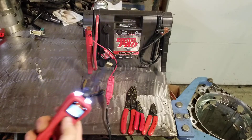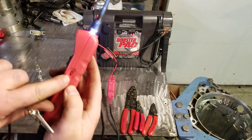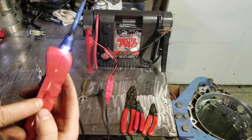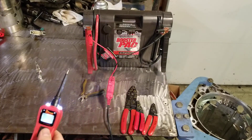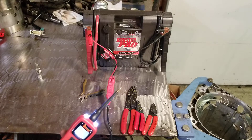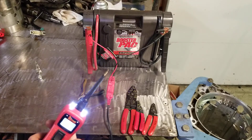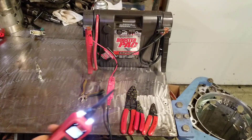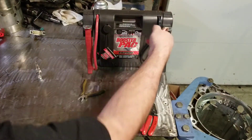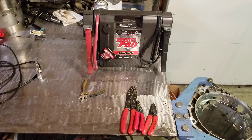These can be handy, but the problem is if you're just poking around and applying power to stuff, you can damage things if you apply power to something you shouldn't. They have a breaker that trips to keep you from burning the wiring up, like that video I showed you when we shorted the wire out. But if I'm applying power to stuff and I don't know what I'm applying it to — if I send 12 volts back to a computer that only wants a 5-volt reference — I can damage it. So you have to be careful. They're great for troubleshooting lighting, blower motors, and window motors. They also make short finder adapters for these things that send a pulse down the wire, and a little box picks up the radio frequency and can tell you where the wire is broken or shorted.